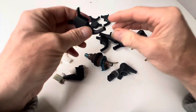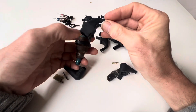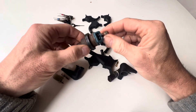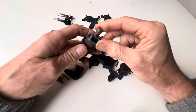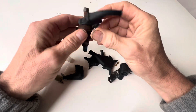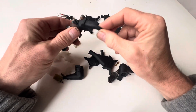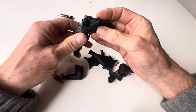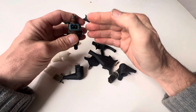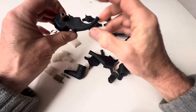Before you get started in replacing your rubber boots you need to be aware that the rubber boots are different for different cars. For example, the Mercedes 280 SL injectors have these curved plugs, whereas on a 450 SL those parts are straight. So when you order a kit from Repro Parts just make sure you select the right kit for your car. These boots are designed to fit right the way over the plug — most people think they're there just to stop dust and moisture getting in, which is true, but crucially they also shield the wires from excessive engine heat. Without these boots, the injector harness wires right next to the engine block can get brittle and start to crack.